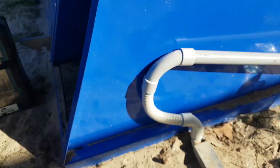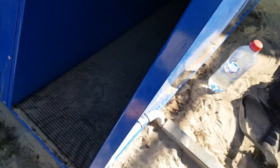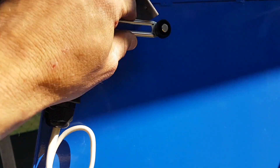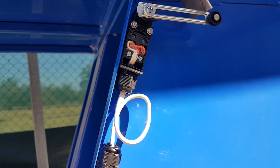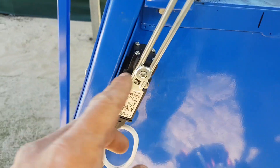Now I'm securing it in place. I've had to be super mindful about where I'm putting the screws because a dog sits in here. You can see these button-head screws and bolts — I'm going to do something similar here. Probably just use three saddles with these little screws — they don't stick out too much. Whenever you're doing any type of switches or anything, make sure you leave a service loop for yourself and for the next guy. It's always a great experience.